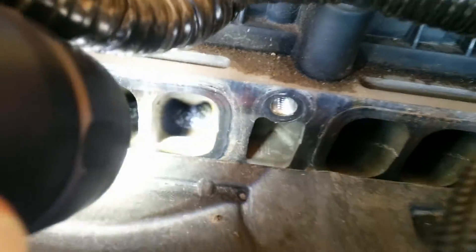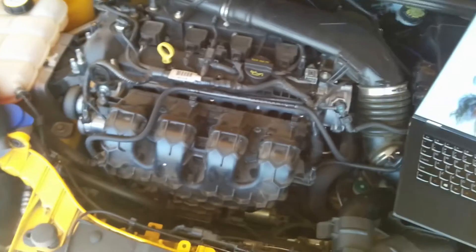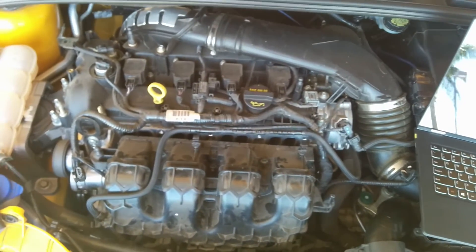Again, I don't experience any issues, but I was just curious to see how bad it was at 25,000. I'm going to keep an eye on it, see if anything changes. But it's kind of disconcerting. So yeah, there you go — 25,000 miles of buildup on cylinder 1 and 4 valves.